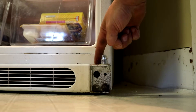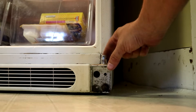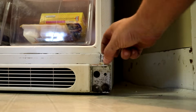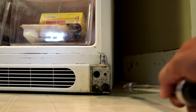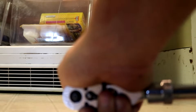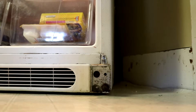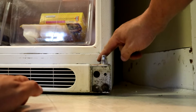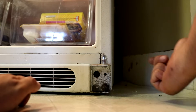Here's a look at the bottom hinge that sticks out from the bottom of the refrigerator, probably about 2 inches or so. Here's the hinge pin, and there is a washer on here — make sure you have your washer and it's in good shape. Make sure the two bolts are tight. Generally what happens is the sheet metal pulls away a little bit and lets this hinge point to the right.